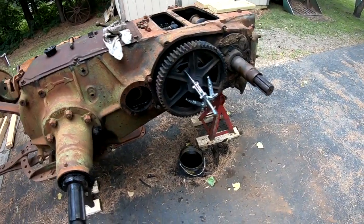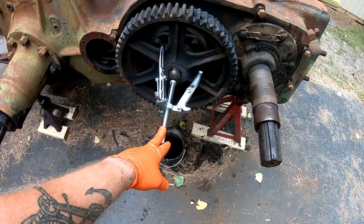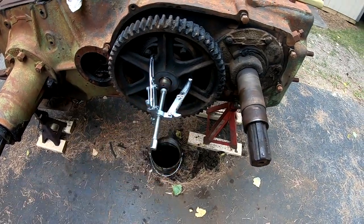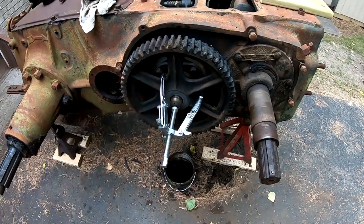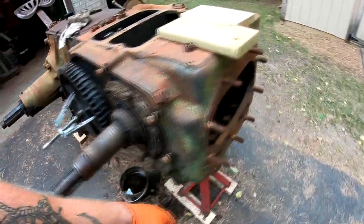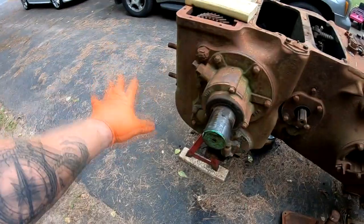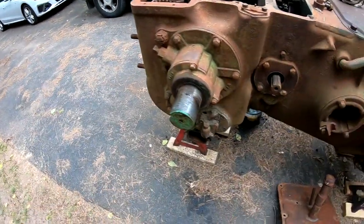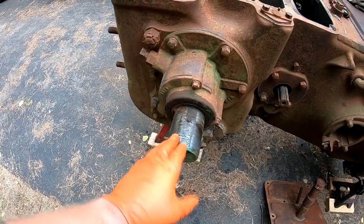Okay guys, it's a little while later. I got that cover off and I've put the puller on the first reduction gear, but I can't get that thing to move. I tried heating up the hub of the gear and it won't slide at all, so I gave up on that for now. The other side, as you can see, does not have a flywheel on it - the 27s and earlier have a keyed crank.